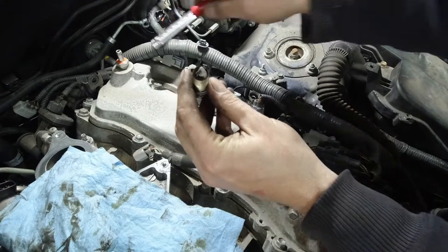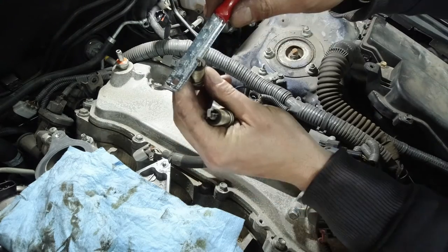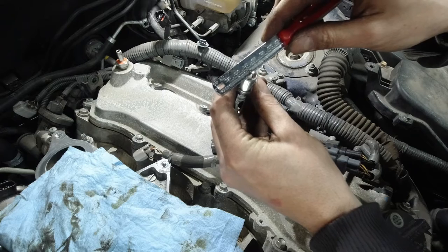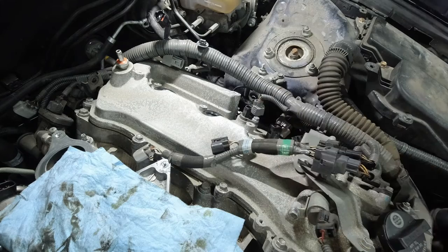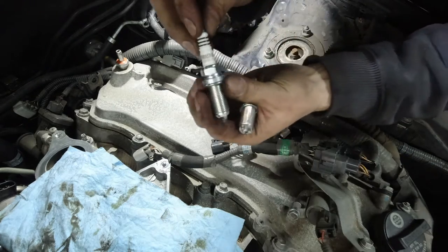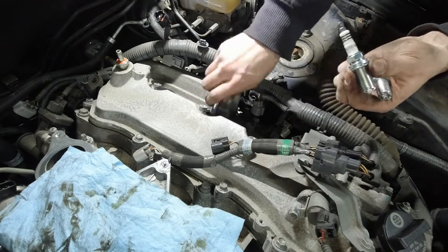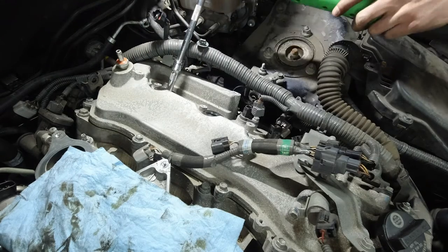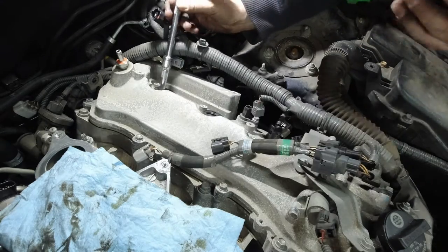Check this out - this last old plug here. The gap is 51, 41, and 50 thousandths. The new one is 42-43. These are pretty gapped out. Don't put cheap spark plugs in here - these are iridium. I'm putting in NGK, about 20 bucks a piece. I'm going to torque these down to 15-18 foot-pounds. Should be alright.